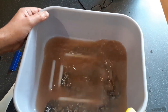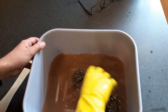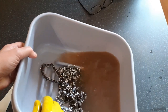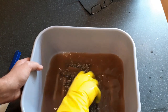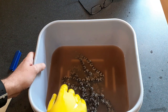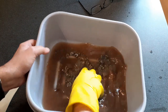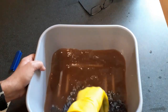All this is just common or garden soda crystals, and it's not even the industrial caustic soda — it's fine on your hands. If these are really dirty, what I may do is put in a squirt of fairy liquid washing liquid, or I may take it out and wash it in a soapy solution first. One thing I do not do, one thing I've never done for years, is actually wash my chains in anything like diesel or petrol. That is a very bad thing to do. This stuff is so cheap, so easily accessible — there's no reason for you to be using anything else.